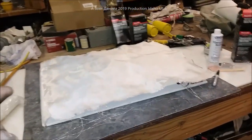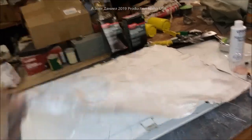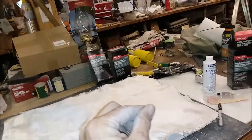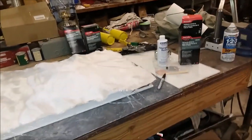Easy fiberglass jobs for FRP — if you have a bathtub that's broken in an RV, this beats the alternatives. As I said, use brass wool, not steel wool — use brass. You can get scrubber pads at the grocery store, and that's what you want to use to prep your surface. Clean it well, and there you go.